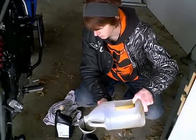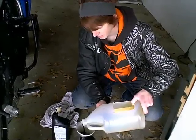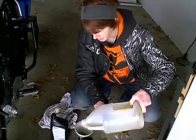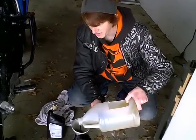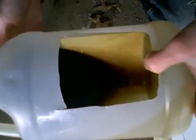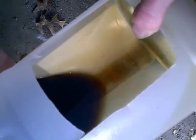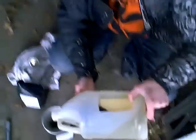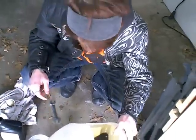There's gelatinous stuff in here. It looks milky — like how it would look when there's coolant. I just realized it's because there was windshield wiper fluid in here. If you get coolant from your radiator into your oil, that's how it'll look — little bits like tapioca, kind of milky. If you can drink bleach and survive with no effects, then you might want to try tasting it.